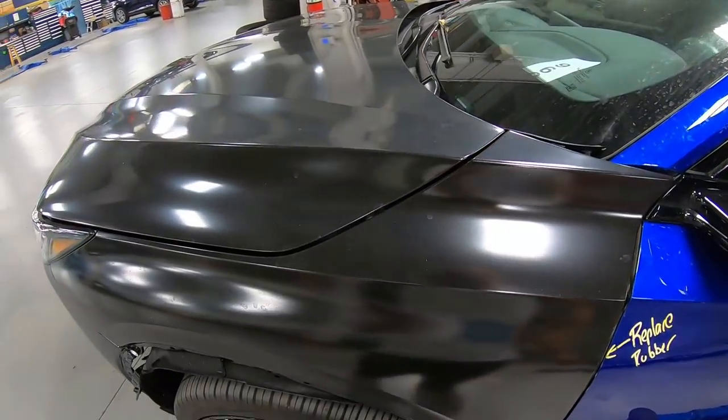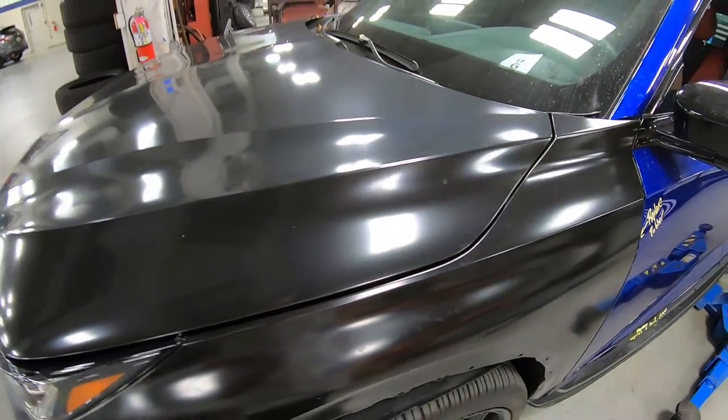So what I did here is I learned my lesson early on in my career. I learned that you need to test fit every single part. You don't want to get all the parts painted and then get to the point where they don't fit after they've been painted. That's one of the worst things. So make sure you do your test fits and your adjustments.